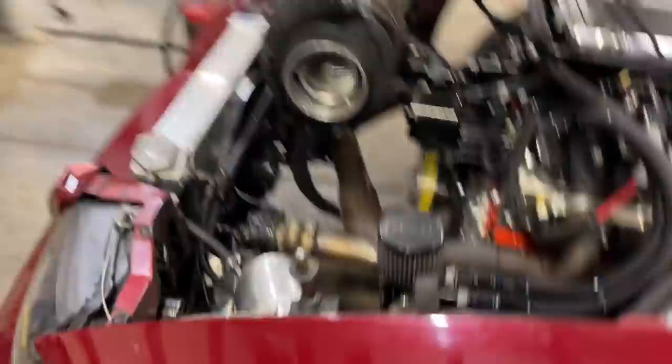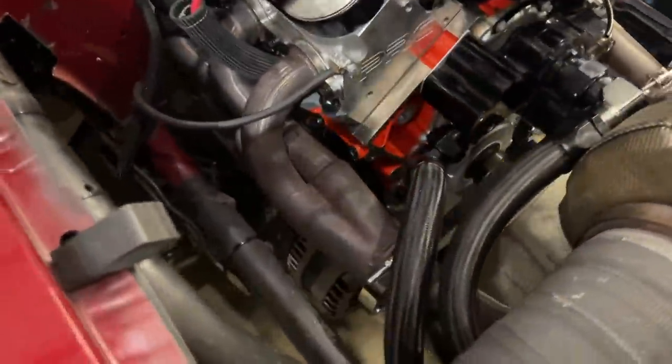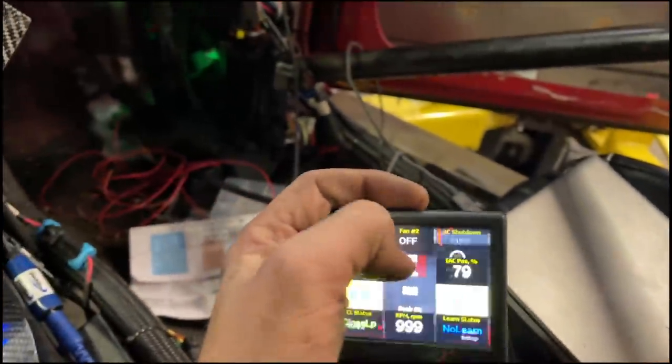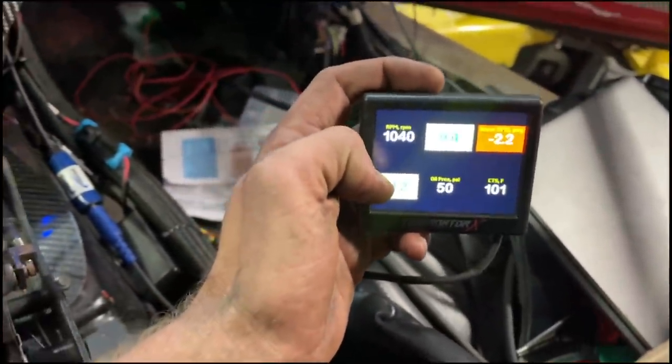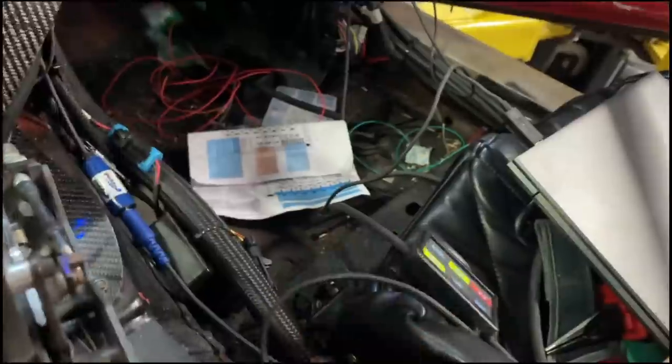As you can see, we have one problem: I'm not charging the battery. It's been creeping down from about 11.7 volts, now it's at 11.2, so we need to figure out what's going on with our alternator. First startup was successful, under one condition — the alternator is only putting out about one volt, which is obviously an issue. Either the belt's not tight enough or Old Faithful is just starting to kick it.